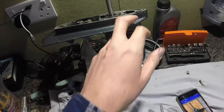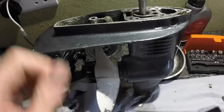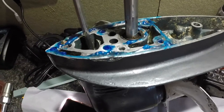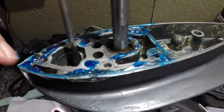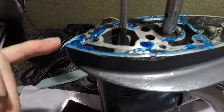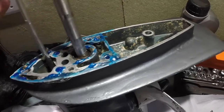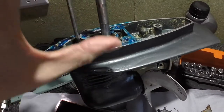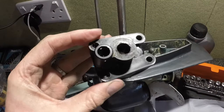We'll use this one for the time being - put some fresh oil in it. The engine seems really nice. Those slight cracks I explained to you earlier - they're not structural. Those four bolts are only for holding the water pump on. That hole there and that hole there are the ones that clamp the bottom to the other bit. So they are just holding the impeller.